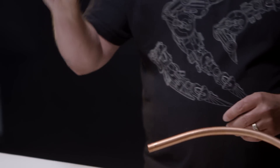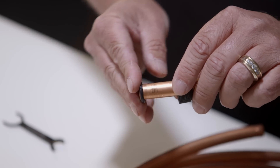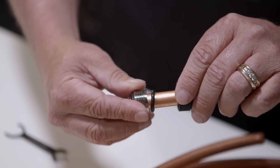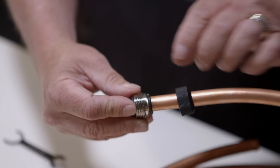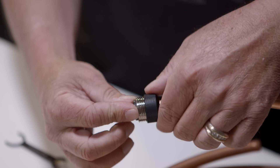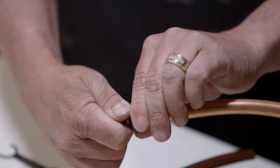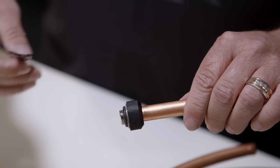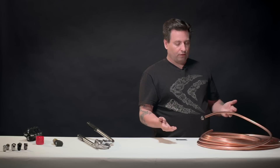The way these work: you take your collar and slide it over the tubing. Next, put your O-ring on. Then put on your barb and slide it nice and snug. With the tubing in, you'll push your O-ring onto the top of the barb and just twist your collar right on top. What will happen is the collar will cause the O-ring to compress, making a nice, waterproof, tight seal. You can give it a little partial turn with the tool if you need to, and you're good to go.